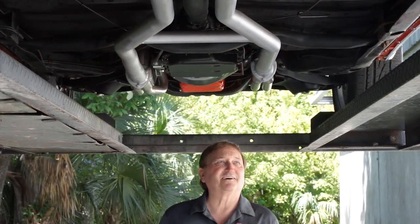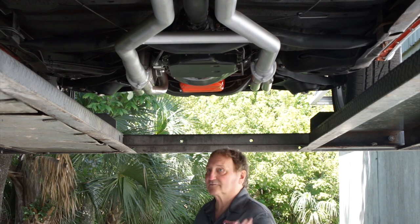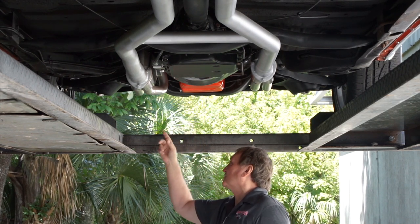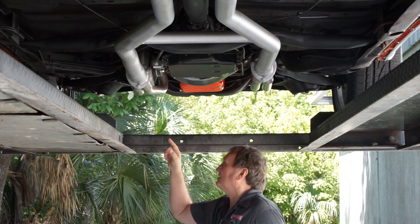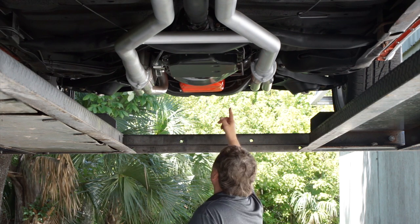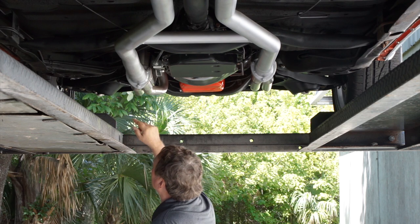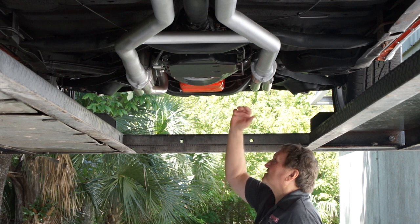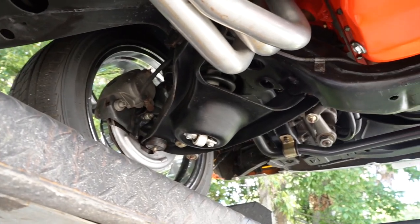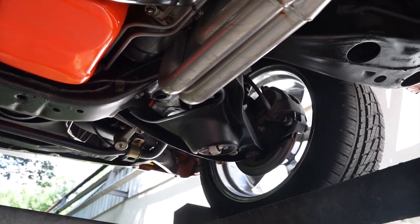This is the underside of an absolutely outstanding 1970 Chevelle, orange with white stripes. This thing is absolutely phenomenal. F-41 heavy-duty sway bar in the front with new bushings, new sway bar ends, new ball joints, new tie rod ends, new steering arm, new steering box, new pitman arm, new idler arm, new transmission cooling lines, new shocks, new springs, new rotors, new calipers, and new associated hardware. The engine has been out and completely refreshed — everything painted nice Chevy orange just the way it should be. There are no leaks whatsoever on the engine, bell housing area, transmission, tail shaft, or anywhere at this point.